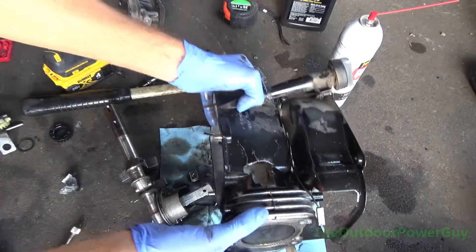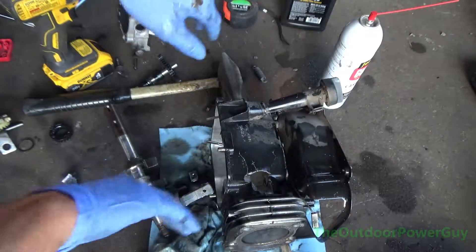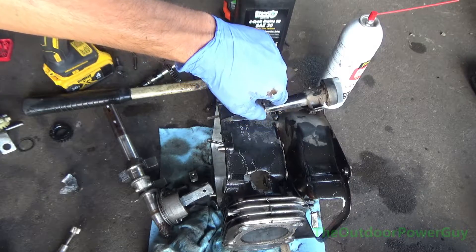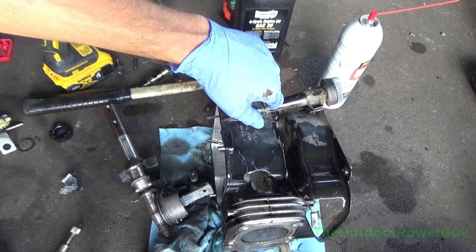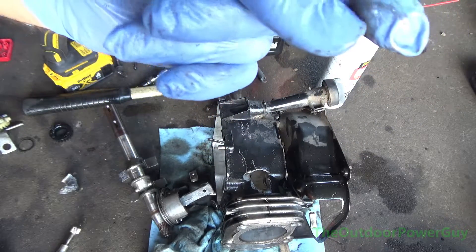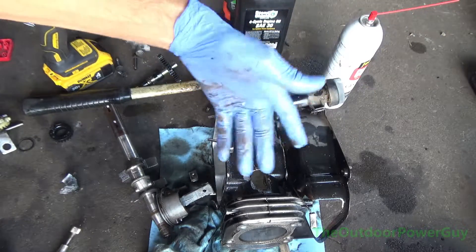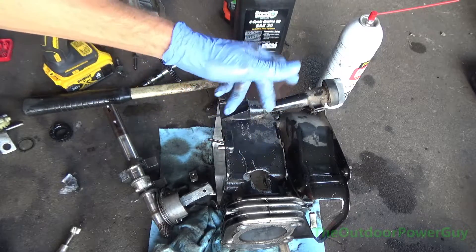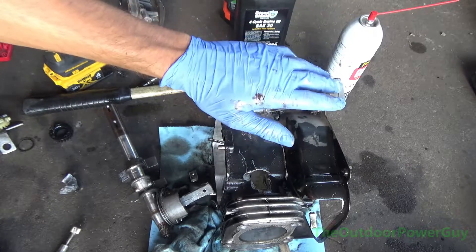The reason I made this video is to show what happens when you do not maintain your equipment — the motor will simply give out. I hope you all learned something today about what happens when a motor gives out due to lack of maintenance. You can see how black and full of metal shavings this oil is, and it's probably the wrong type — probably non-detergent oil, which will also cause this to happen. Always use 30-weight in a Briggs; you can use 10W-30 but you have to check it more often. I'm going to clean this mess up and I'll see you all in the next video. Bye for now.